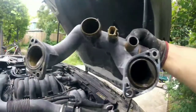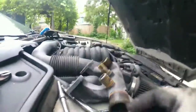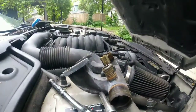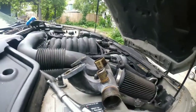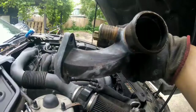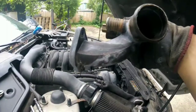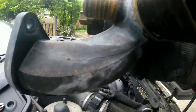Okay guys, you see my issue right there? This is my old one, just taking it out. Right here — look at all those cracks. It started from all the way over here, all the way up here. That's where my leak is. I first thought my car was overheating because limp mode locked me out — the car won't go more than 20 miles an hour. But it's not overheating, it's just a cracked plastic pipe. Can you see the hairline crack?